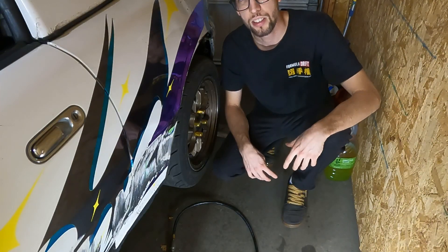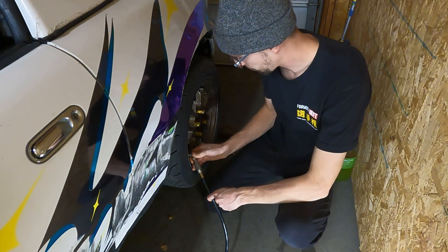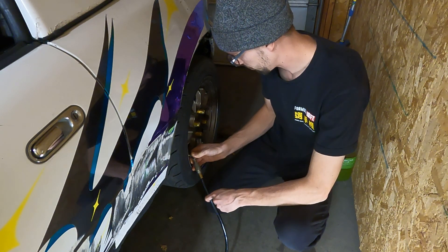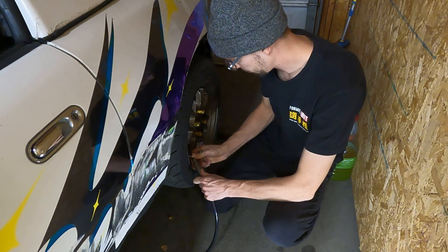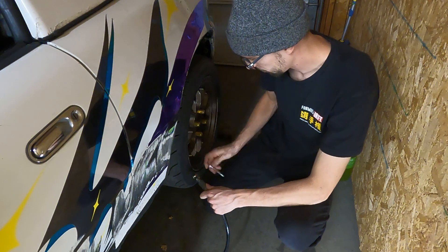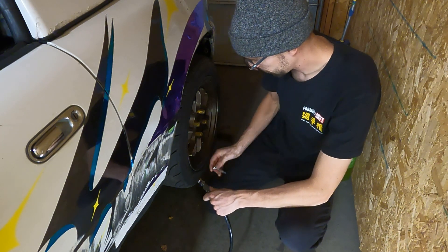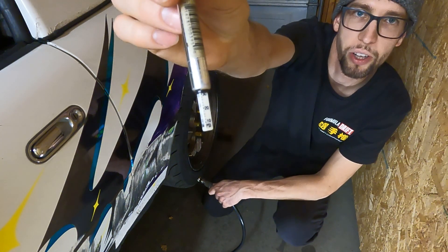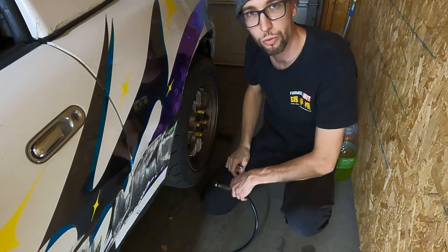The next item of business is checking your tires and making sure they're not sitting low. You don't want to leave your tires almost empty, especially if the vehicle is sitting on the ground — that puts a lot of stress on the sidewall of the tire and it's probably not going to last sitting all winter. I know I aired them down at the last event and probably didn't put air back in them. That goes for daily driving vehicles as well: as the temperature goes down outside, the tire pressure also drops. 30 PSI should last all winter and not drop to a dangerous level.